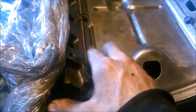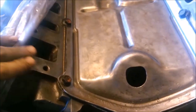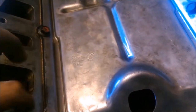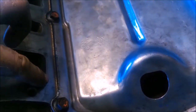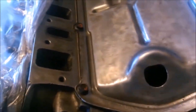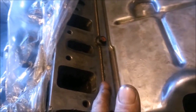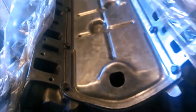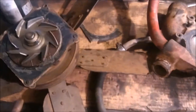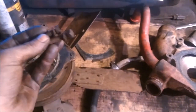You'll have a little black line that might start to peel up later. Before we paint, we'll mask this off, put our gasket on, slice it around the bottom of the gasket with a razor blade, and peel off the surface that's going to be exposed — make sure that gets painted too. These surfaces are going to be sealed up, but this little edge will start to rust and get under and leak. So we separate our water pump housing here. Here's our impeller, here are the bolts — these ones won't come out without taking the pulley off. The larger one with the nut goes in the top. We'll clean it up, prep it, and paint the underside so we can bolt it down.